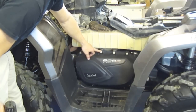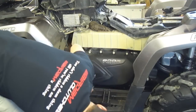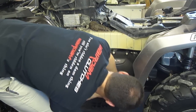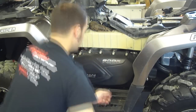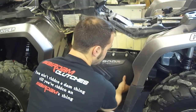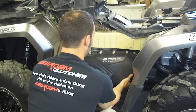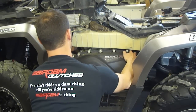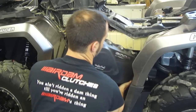I always leave the center bolt in last — that will be the last one I pull out. Now once you've got all the bolts out, this cover is a little trickier to get off than the Gen 1's because it's so tight with these floorboards. You've got a little slot down here in the back where you've got to fish out your drain plug. You're going to have to fish it up and then kind of roll it, working the front over and around the primary, and then it will just slip right up.